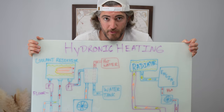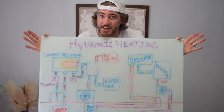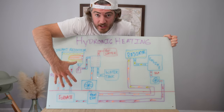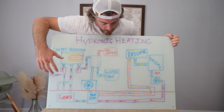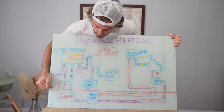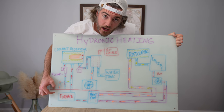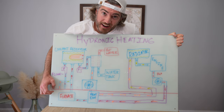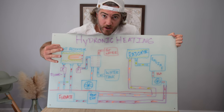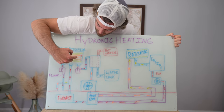Back to the whiteboard. Now that we know how heat exchangers work, here is the detailed overview — it might look intimidating but it really isn't bad. Here we have our heating system in the back of the van, and the front engine of the actual vehicle. This red line represents the floor of the van — imagine it about an inch thick with our heated floor running through it. In terms of coolant loops, there are three: the first is for our hot water and hot air.